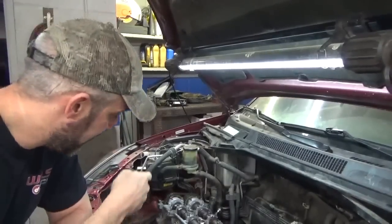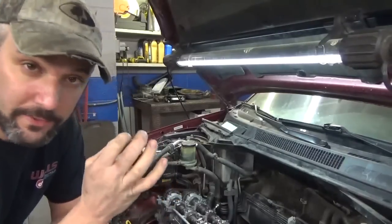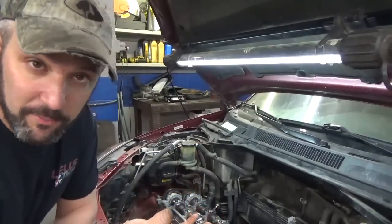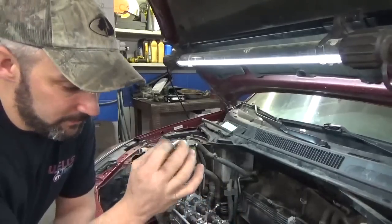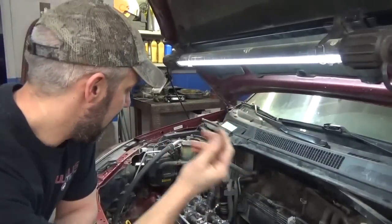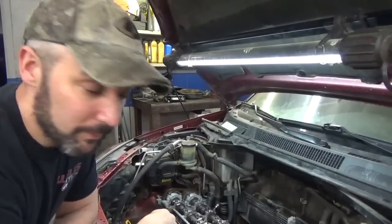Before I started rolling it over there, obviously we still had our marks up here on the cams, and down on the crank you don't have a mark anymore though, because your mark was on that orange link and on that lower sprocket. So we knew the timing was on when we put the cover on. Well, hopefully it did. So once the cover's on, all you can see is the end of the crank and the seal. So I just marked a dot on the keyway, marked a dot on the seal. We rotated around here a few more times off camera, and come up here, double check our cam marks. They're right on the money. Mark on our crank right back where it was.